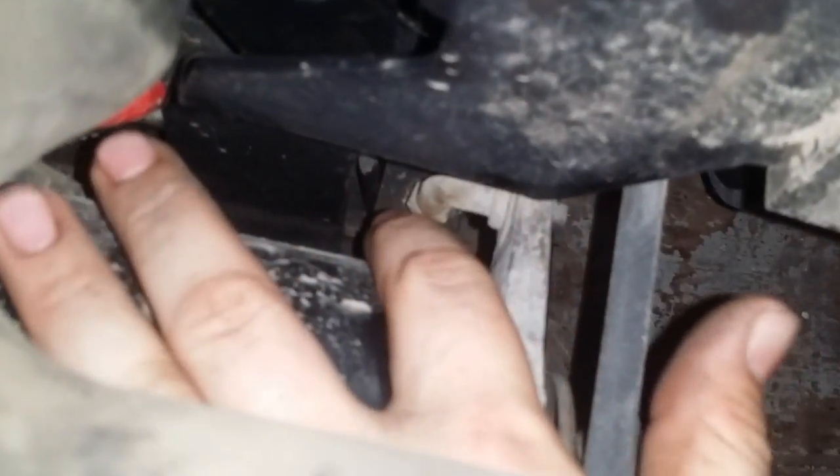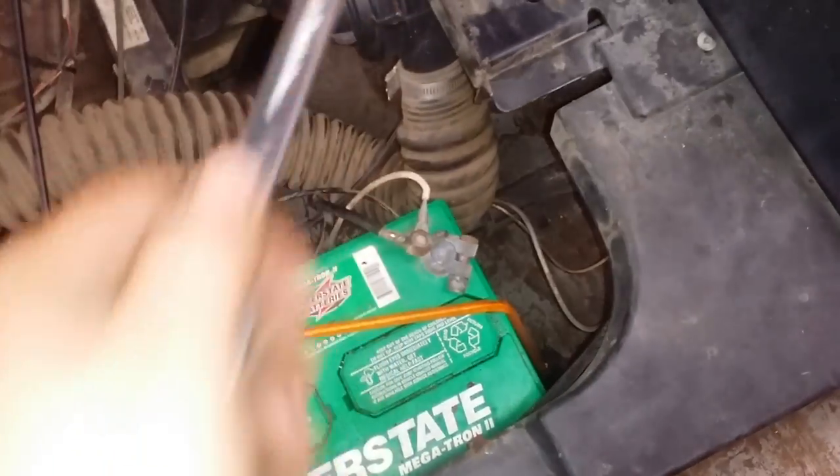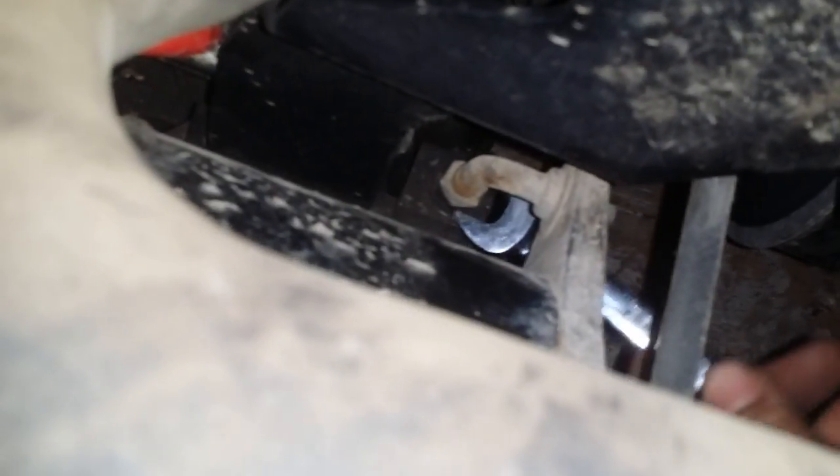To loosen the starter generator, look down here — you see this little crooked piece. There are two 14mm bolts down there. Grab a 14mm wrench. You want to be very careful because that is the positive battery terminal. Touch that and something metal will make big sparks — very unpleasant. Simply reach down in here and knock that loose, reach in with your hand and spin it off a bit so now it's loose.